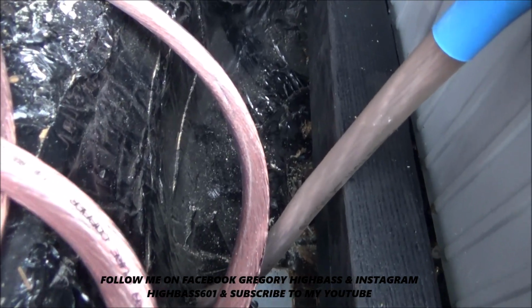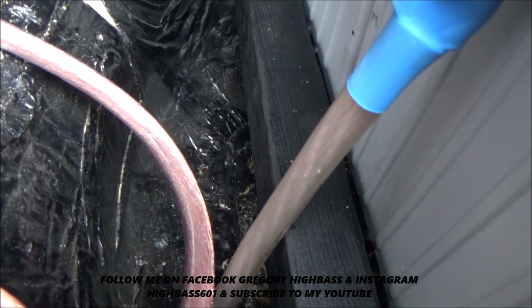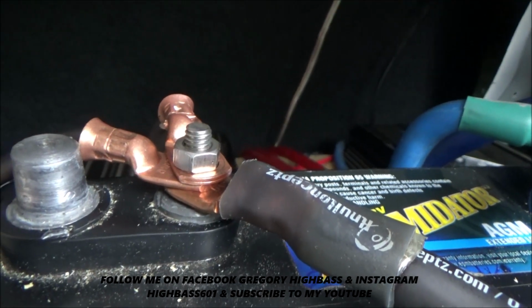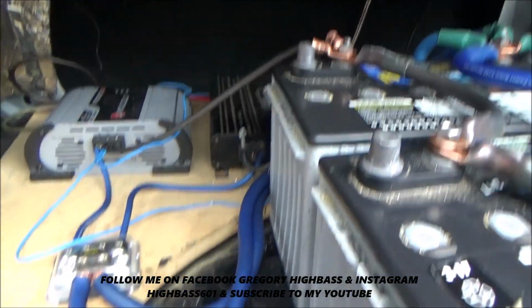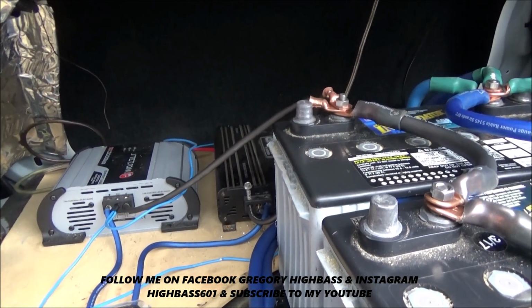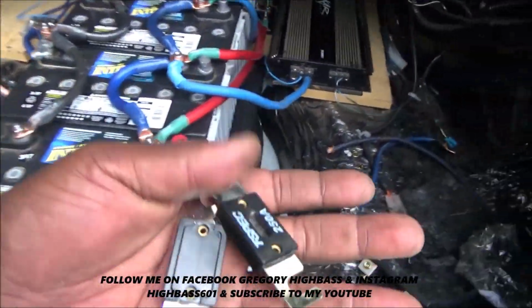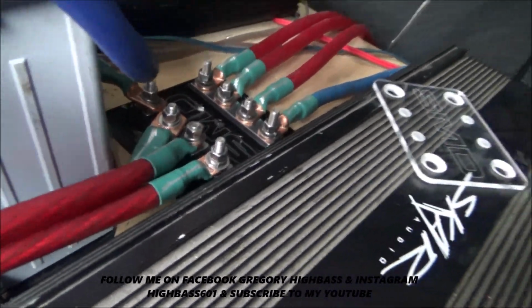Like I said, I will be running 3 to 4 grounds under the car next. But, you know, rule of thumb, I always ground my amps on the frame. I do that. But in this case, I'm gonna be running grounds from up under the car to the battery. So it'll be kind of parallel, like a parallel ground. It'll work fine, like I said. So that's that. And I also got that done. No fuses in it, it's not even tightened.